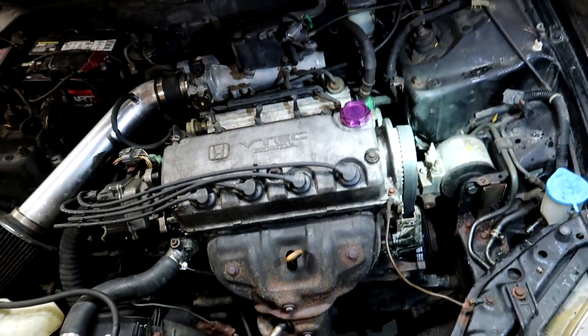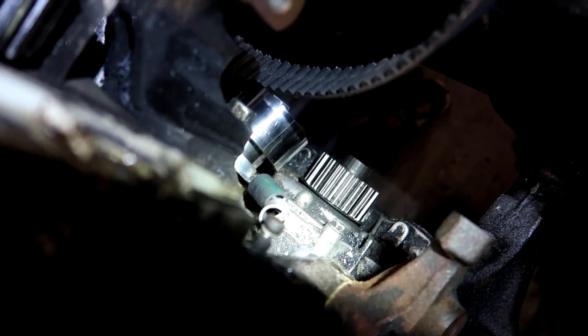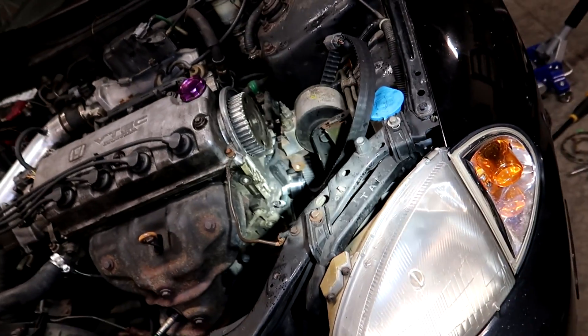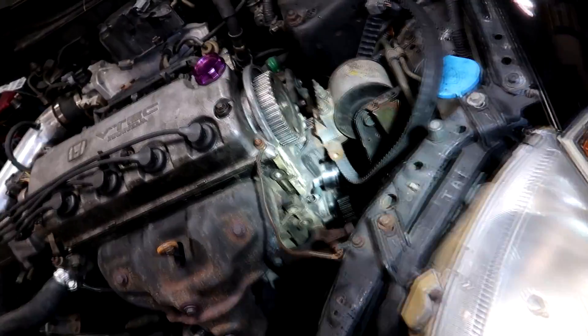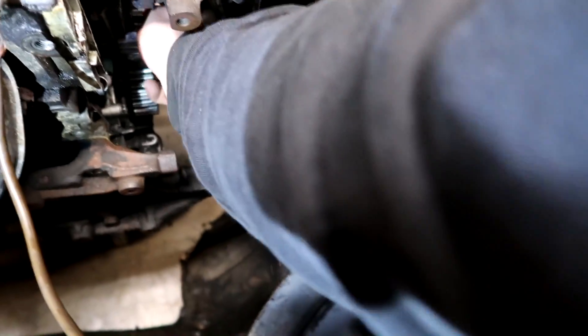With the cover off, it appears somebody tried to put a timing belt kit or tensioner in it because the tensioner bolt way down there is brand new. The belt was just walking its way off. I'm going to get the crank pulley off and once it's off I'll take the lower cover off and really understand what's going on with this timing belt. I'm going to take an educated guess that's why it's not running. These little single cams are mostly not interference motors — you can get away with a slightly bent valve. I don't think I've ever crashed valves on a stock single cam Honda. I got the wheel pulled off, the shroud out of the way — I'll pull the crank pulley bolt, try to get that lower cover off and see what we find.